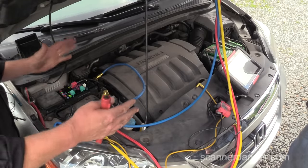I totally forgot — at the end of this video I showed the rest using the test light and not my multimeter. I started with the multimeter and ended with the test light. The test light is bright on the feed side with the circuit loaded — that's what that switch confirms. Test light does not light on the ground — that is a good ground. If that ground was bad, the test light would light.